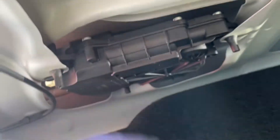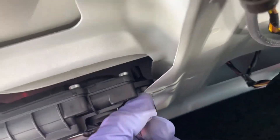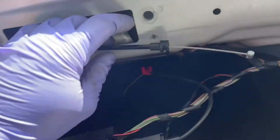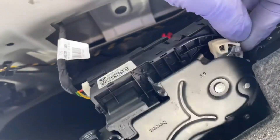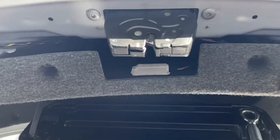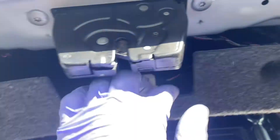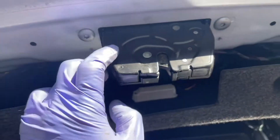My actuator is in, plugged up, and I pulled these through. I had to use a pair of needle-nose pliers to keep yanking it down until the little flared portion goes through, but it goes in. I ran my cable all the way through here — run it through there, then go there and clip it right in. After running that cable in, I ran it through here and also through here so this can go back in. Went ahead and bolted this back in with the T30s.